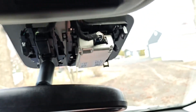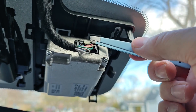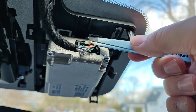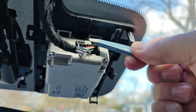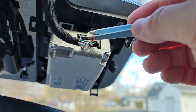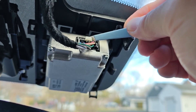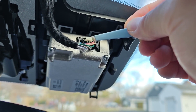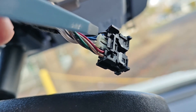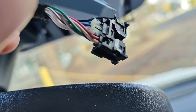The cable they gave us plugs right into the back side of the camera. Probably one of the hardest things to do on most of these cars is these plugs usually have some type of lock to keep them in place. On the Bolt EUV there's a white tab — you can reach back here with a screwdriver or a pair of tweezers and that will release that little pin. Then once you pull this little white tab back there is another locking pin that you have to hold down and pull straight back on the plug to release it and pull it out of the back of the camera.